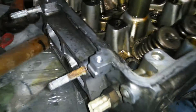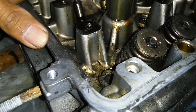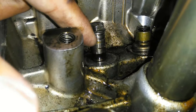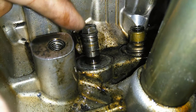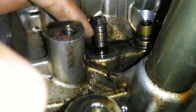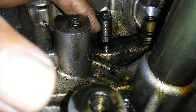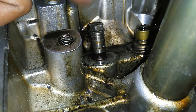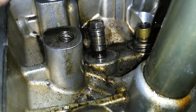Another method I found: I tapped out the guide just to fit a 10 millimeter bolt. The 10 millimeter is slightly larger than the diameter of the guide, so it was very easy to tap — I didn't get much resistance and it was very easy. Then I just ran the bolt in and tightened it up. That was already way ahead of the other method. No drilling required.